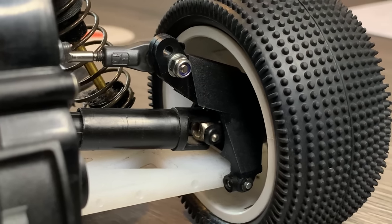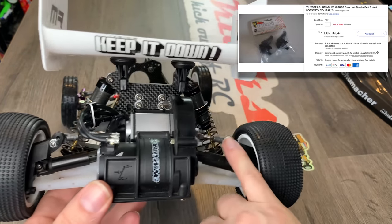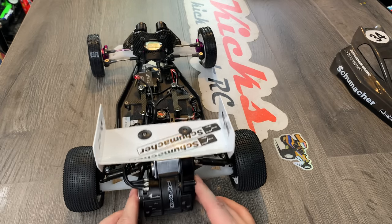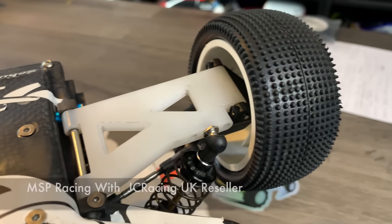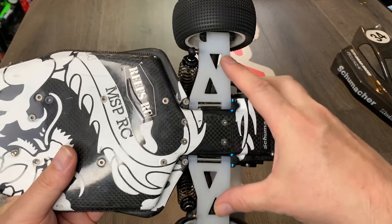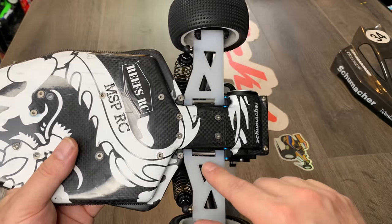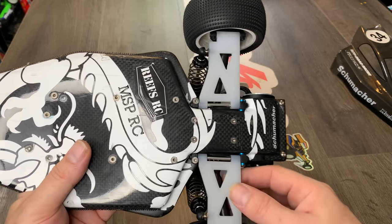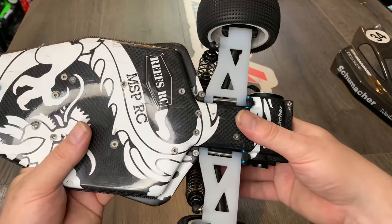The hubs are from Cougar 2 — not the original ones. The reason for those is you get two adjustments you can make, helping to dial in the back of the car and keep all the camber under control. The rear arms are again from MSPRC — these have been out for a while and I'm pretty happy with them. I did have one that was drilled out too much with too much play, so I bought another, but the others have been fine.